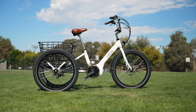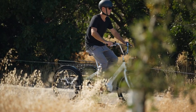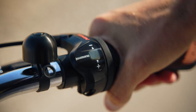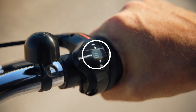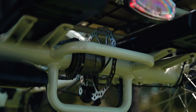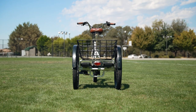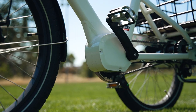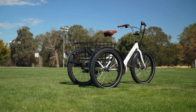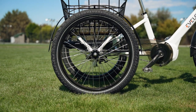The Compass is kind of like a car with multiple gears. When you start out at low speeds, you throw it in first gear for maximum torque, and as you pick up speed, you switch into the higher gears for cruising. More impressive still is that the Compass utilizes a rear differential, making it a true two-wheel-drive electric trike. The power from the mid-drive motor is split evenly between both rear wheels, which provides solid traction and prevents wheel slip during tight turns and when accelerating on loose terrain.